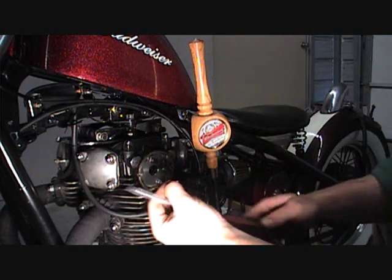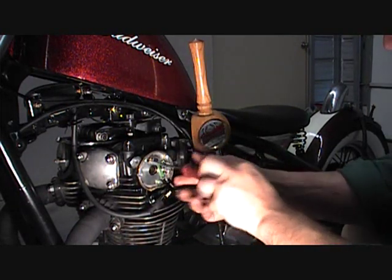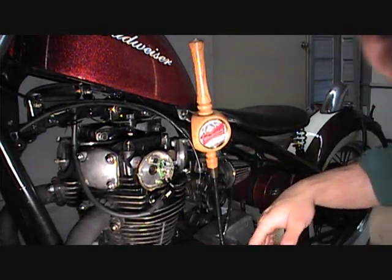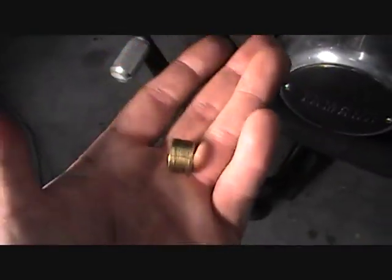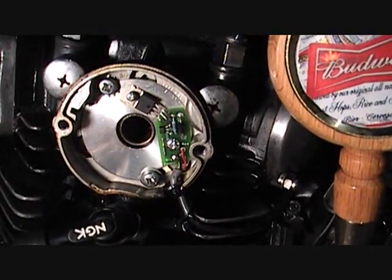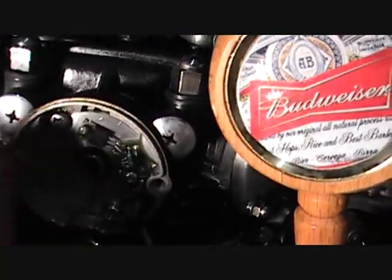There's another bolt for the top — put it in there. Okay, the PANCO is in. Now on this side, you'll notice there are holes here for the bushings. This is where your brass bushings will go. You'll have one brass and one steel. On the PANCO side, you'll only want to put the brass in. The way I put it in is I'll set it in the hole, like such.